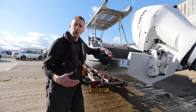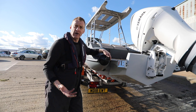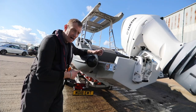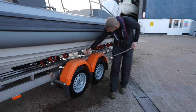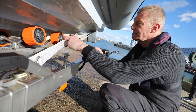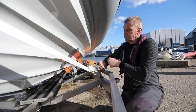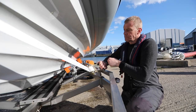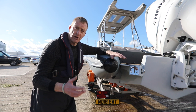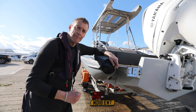So that's our boat back on the trailer — we've done winching it on, we've done driving it on. Now to get it ready for the road, the first thing we've got to do is give it a good flush. That's not always possible at a slipway but we're quite lucky here. Washing requires all over the engine, bottom of the hull, and most importantly on the trailer — do the wheels and the brakes, and the more water you can get in there the better. If you're lucky you have auto-flushing hubs. Then put the straps on: strap from the stern pulling the boat forward, strap from the bow pulling the boat back. And then when you drive down the road, do a mile, put the brakes on — not hard, but put the brakes on so everything settles. Find yourself a lay-by, pull in, recheck all your straps. You don't want to find 50 miles later the poor thing's loose. Do a mile, stop, recheck everything, then drive home.